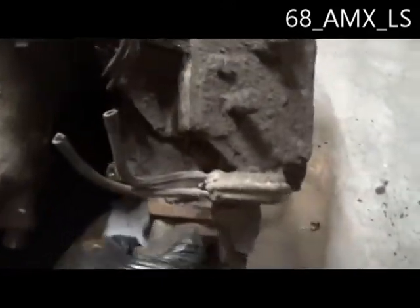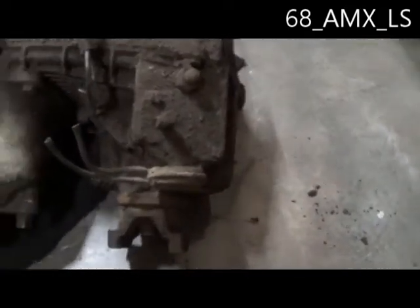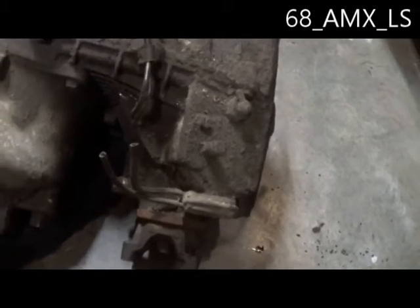Here's my problemo with this thing. They say even if you take the front drive shaft off, this thing won't move — because by the magic of Borg Warner, somehow this has some sort of something in it that keeps it from moving. But these outputs are locked together and don't seem to have any kind of planetary or clutch disc or something in there to stop them from doing anything. That's why we're going to rip it apart and have a look for ourselves.